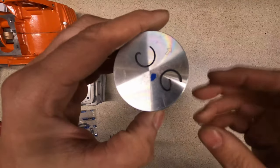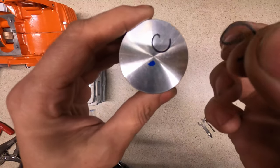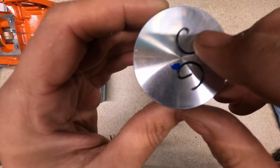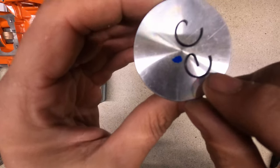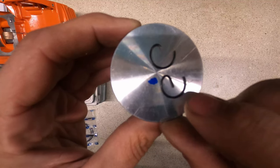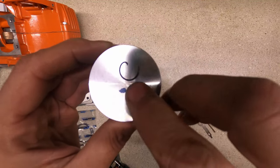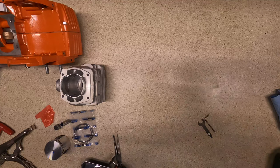I've seen a lot of people recommend cutting a little bit of the tang off from the circlip that holds the piston in. You can see here about what I did — just cutting off quite a little bit. Apparently there's a weight issue; too much tang causes the circlip to come loose, the engine ingests it, and bad things happen.